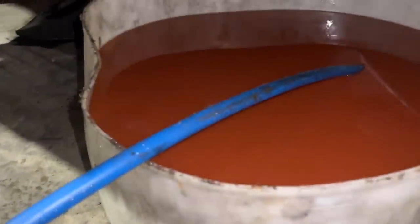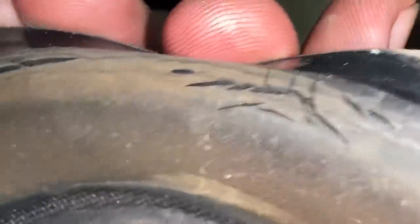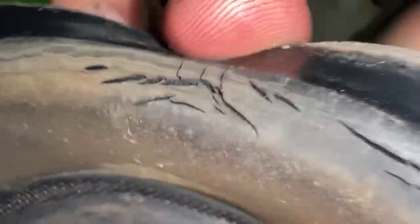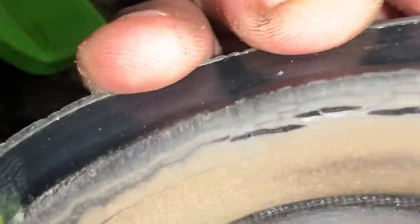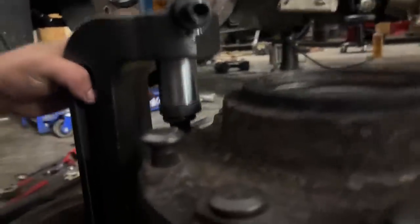This is the nastiest looking coolant you've ever going to see — it only had water in it when he bought it. He drained it, flushed it, put coolant in it, but it's terrible. We're replacing the brake diaphragms in the tag axle; they were very dry rotted and needed to be done. All the other brake chambers have been replaced or we're replacing them on the bus — this one we're just doing diaphragms. As we're replacing the wheel studs here, this Tiger Tools stud press is really cool; you don't have to lift up the heavy hub and put it on a press.